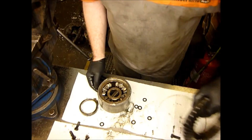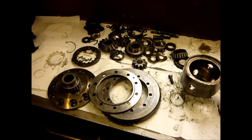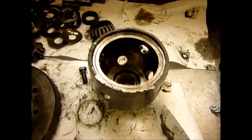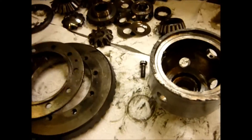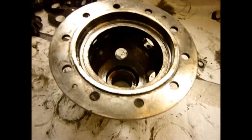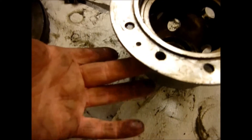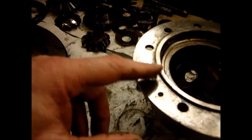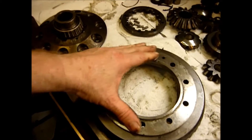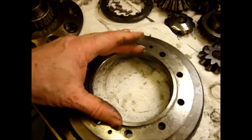Some time later we've got the ARB completely in bits. I'm going to try and explain this and give you a demonstration of how the pegging would have stopped this happening. This is the case which is the centre tube of the ARB — this piece here should be part of that and has sheared off. That would be one piece like that. Now under here coming up where my finger is would be the crown wheel, and then on the top here would be the end flange plate. So if I take the end flange plate away, take the spacer away, slide this up the imaginary tube — reaching this piece here, so underneath here would be this piece which is sheared off, and then on top of there that piece goes on.